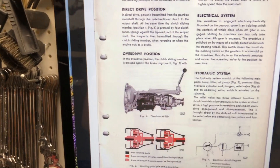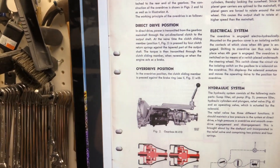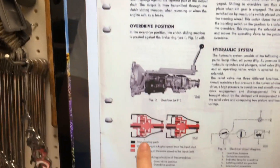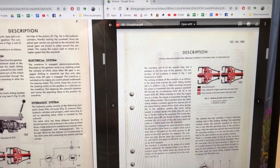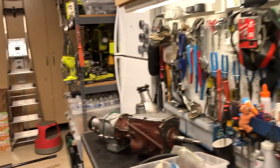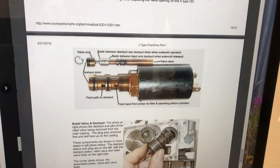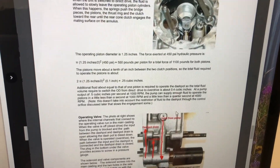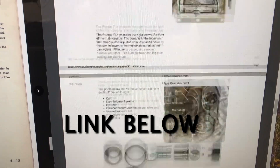In the diagram, black represents non-rotating parts, red represents parts rotating at higher speed than the input shaft, and the parts rotating at the same speed as the input shaft are when you are not engaged in overdrive. So this is direct drive and overdrive — it's the same for both. I was thinking for many years it was a little bit different, but they are fundamentally the same in the way they engage, which is why they look so similar on the inside. BuckeyeTriumphs.org has a wonderful resource that shows every little bit of the J-type solenoid expounded upon — there might be a few minor differences but for the most part it looks identical.